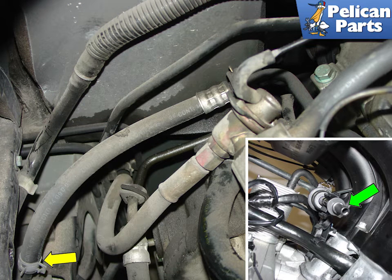In this image, there are two items that are a bit difficult to disconnect. The power steering return line has a rubber hose at this junction and mates into a barb attached to another hose. Remove the clamp and then pull off the hose — do not cut this hose; it is expensive and not easy to replace. The insert shows the fuel tank vent line connection, which has mated underneath the manifold. It is also very difficult to get to; you have to reach in there and pull or disconnect the line further upstream.